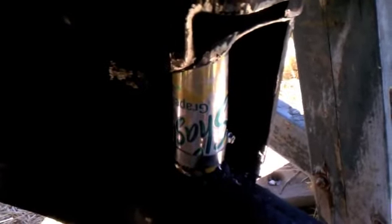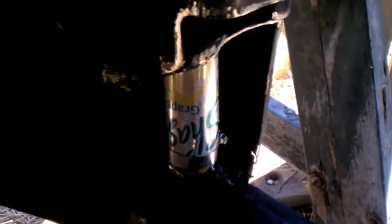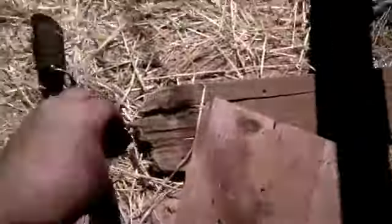And then on the top end, I'll just hook the vacuum hose up to the, what's that thing, defroster. The thing is, the hose that comes with the Volkswagen, the original stuff, this is what it is, and it just doesn't do the job. All this stuff, there's like tar on it. It's probably really hard to see, but that fell down in there and helped cause all the rot that's in here. Original equipment isn't good, so that's why I decided to put a plastic hose in there. That plastic will probably live much longer than I will.